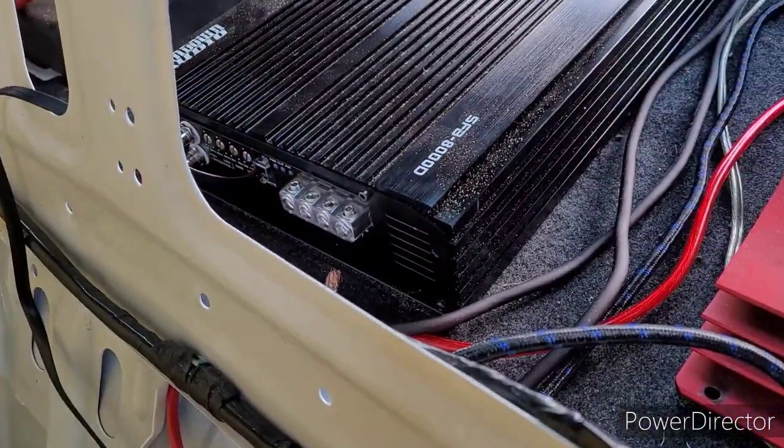Like I said, I read it in the comments, which made a lot of sense, because when I hooked the bass knob up, I didn't readjust the amp for it. My amp was adjusted to play without the bass knob. Now that I have the bass knob, guys, I need to be able to crank it all the way up without distorting or clipping it. You see what I'm saying? So that's what we're doing today.